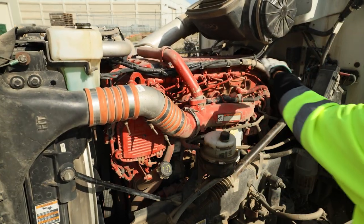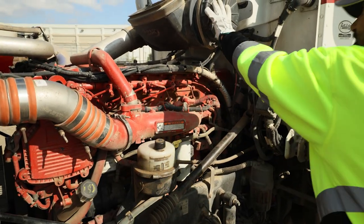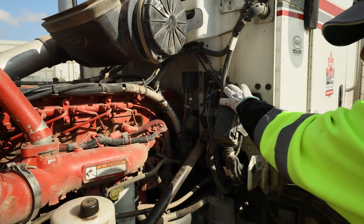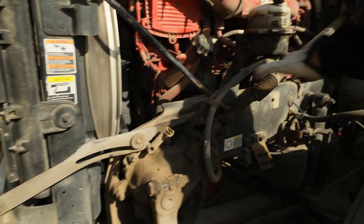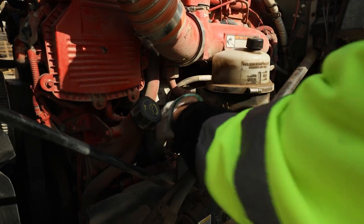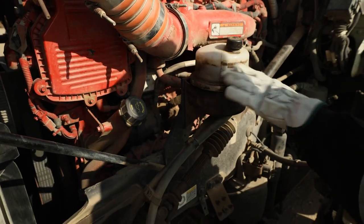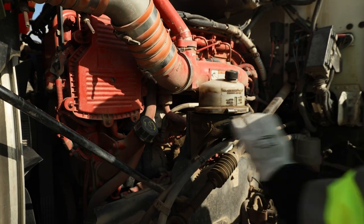Electrical: I don't see any exposed wiring. Engine itself: no noticeable leaks. Air filter is secure in place, not obstructed. Electrical relays and fuses all securely mounted. Coming back over to the left, I'm going to check my frame rails — no cracks or damage. Oil fill cap secure in place. Air compressor: securely mounted, all braided lines secure, inlet and outlets, no noticeable leaks. Power steering: making sure we have a good level, cap is secure and in place, no leaks.